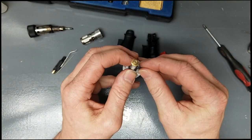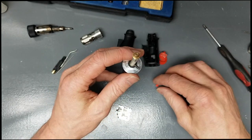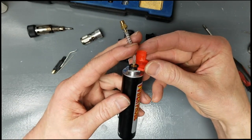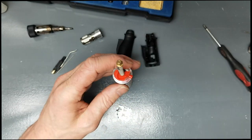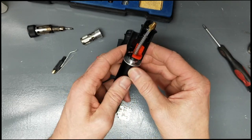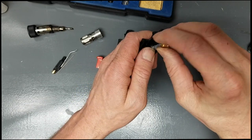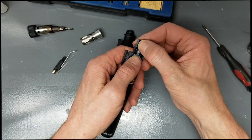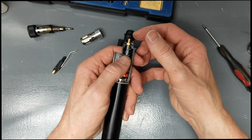Put that right back where it needs to be, then stick it back on there. Replace the on/off switch and make sure to get it below that little brass ring — it's kind of hard to see, but make sure it is below that otherwise you won't be able to turn it on once it's put back together. Then slide the button-side part on first, push the little spring down so it is compressed against the little stop, and then stick the nozzle into its receptacle and press it into place. The flat spot needs to be up for it to close properly.